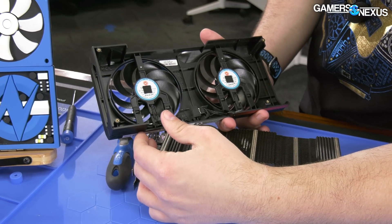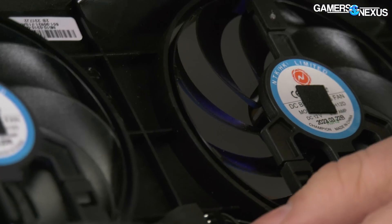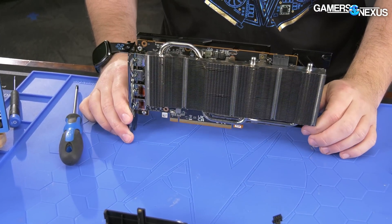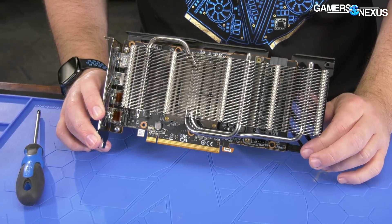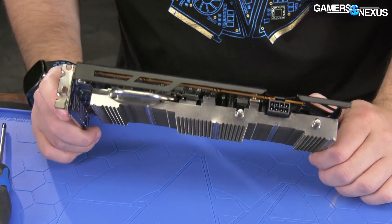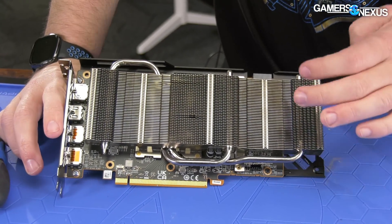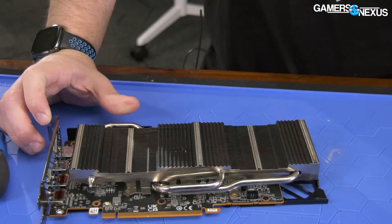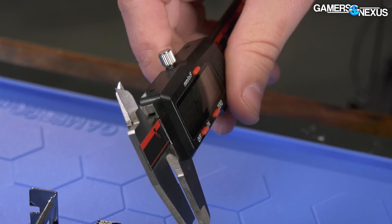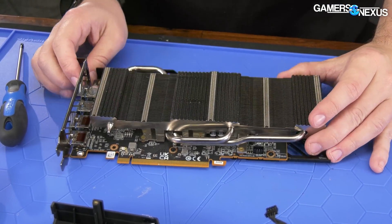For the fan spec, these are NTHK fans — 12-volt, 0.35-amp fans. Here's the actual cooling solution, a little dinged up in some places. We've got the 8-pin up top, a horizontal fin stack with some raised and lowered areas — lowered where fan clearance is needed. It looks like there's one larger heat pipe. This heat pipe looks like a 6mm. So it's got a 6mm pipe here, and it looks like maybe a two-heat pipe design. Let's take it apart further and find out.